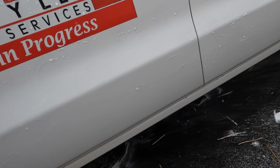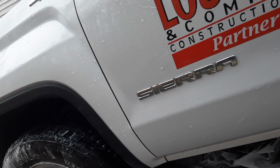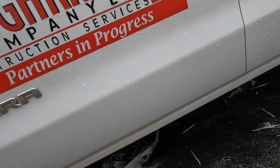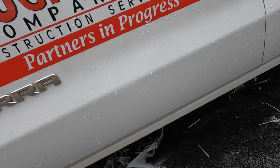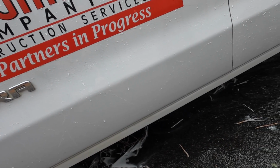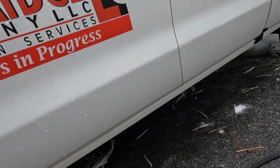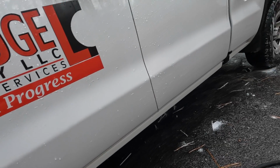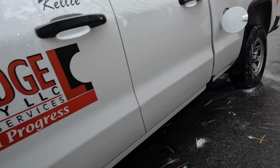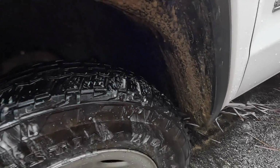That's awesome. That's the benefit of an APC rinse. What type of APC? You can use pretty much any type of all-purpose cleaner or degreaser. Meguiar's Super Degreaser or their all-purpose cleaner. Anything really. Super Clean, any of that stuff you can use. I dilute those types of APCs 1 to 4. And that's usually strong enough. And it also kind of pre-cleans the tires. Ooh, mud.